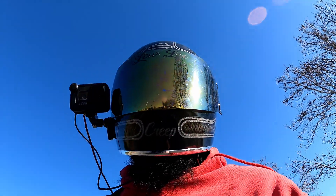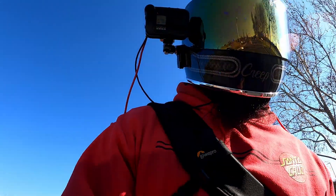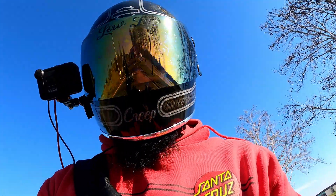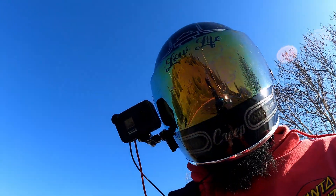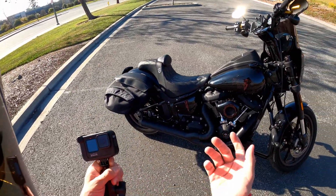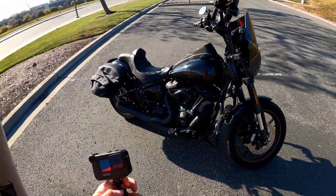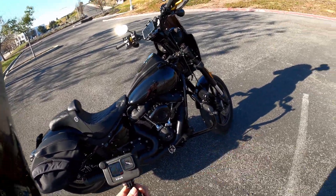Sometimes in my comments, when I had the Trask air filter, people were wondering how I changed the color. A lot of people just don't know — that red color is just the oil they put into the filter. It helps protect your engine by catching debris and minor particles. That's why you don't see the red anymore; it oxidizes and turns gray. You can recharge it — K&N sells a kit, you can go red or black, it's about $20.